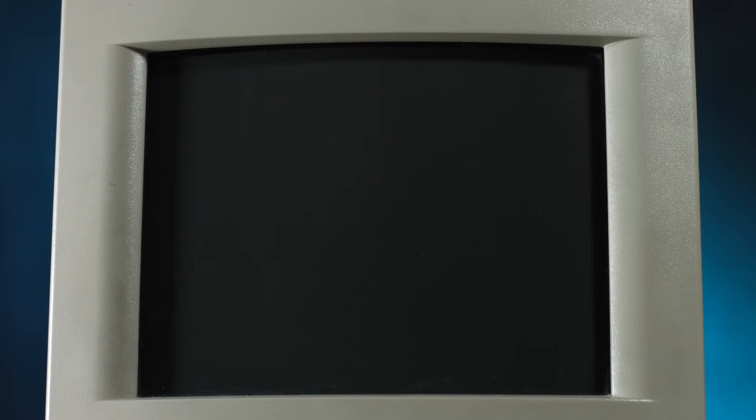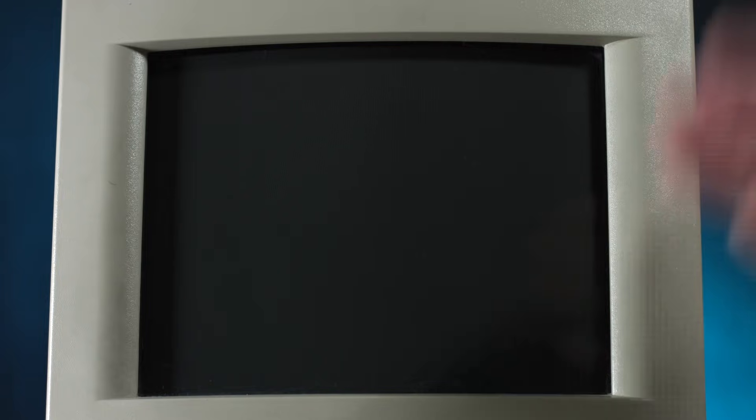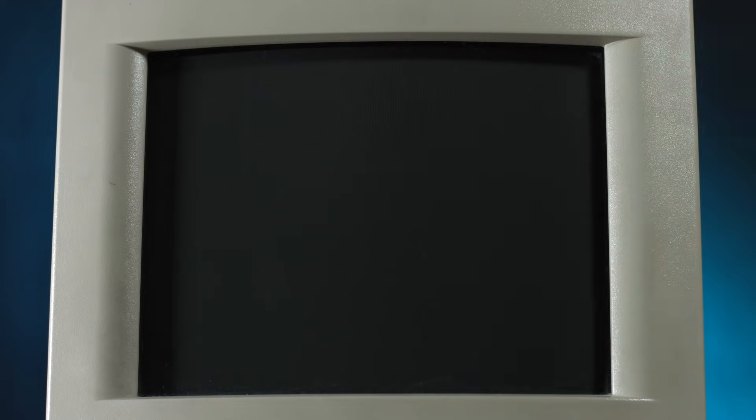I'm just going to call the screen dead. What I'm going to try is put the other board back in and see if I can get it to boot. Because sometimes if it sits plugged in for a while with the power turned on, miraculously I can get it to boot. If it boots and the screen works, we can safely assume the screen by itself is not malfunctioning. However, if the computer turns on with the other board but the screen just does this, then I guess we can assume the screen is busted. It was already acting funny — flickering like crazy. It might be broke, and that would suck. That's going to be an overnight thing because it usually takes hours before it's bootable again with that other board.